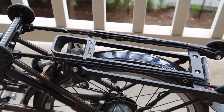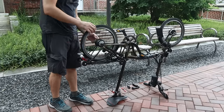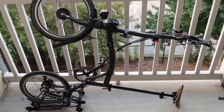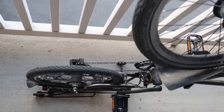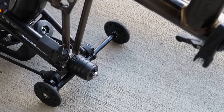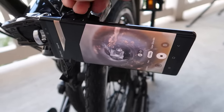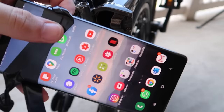Finally, if you have one of the older models of the Brompton with the shifters on top of the handlebar, flipping it around to remove the wheel will damage your shifters. In that case, you may want to keep the bike standing up — it allows you to remove both wheels without the handlebar touching the ground. Keep in mind the bike is not that stable in this position, so be careful. Having the wheel extender will make the bike more stable. Let me know in the comments if you know any other hacks not mentioned here — if they're good, I'll feature them in a future video and give you the credit. Thanks for watching!